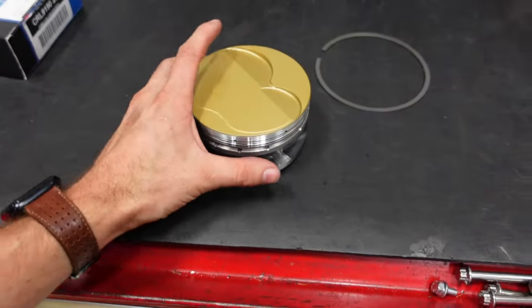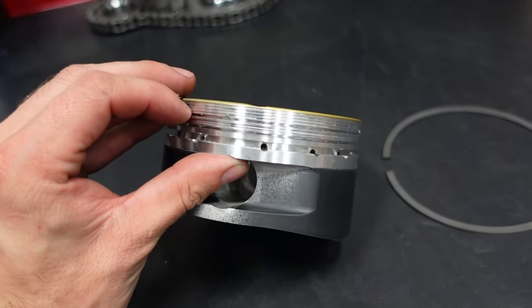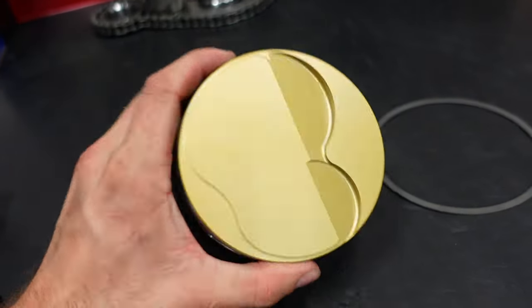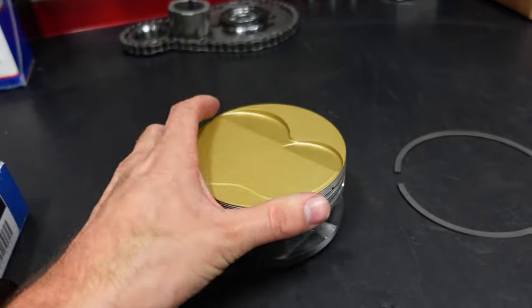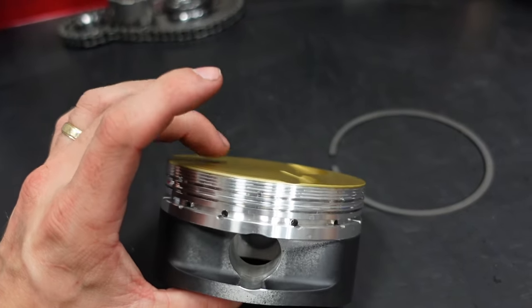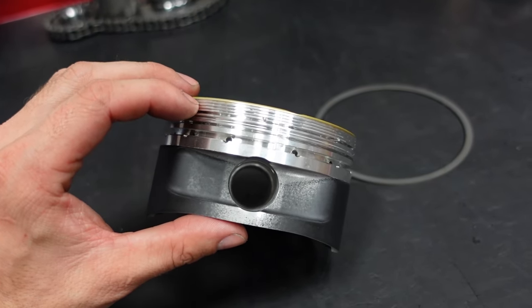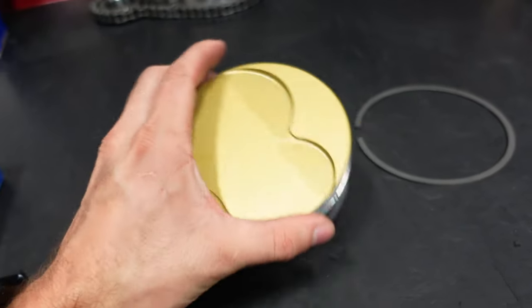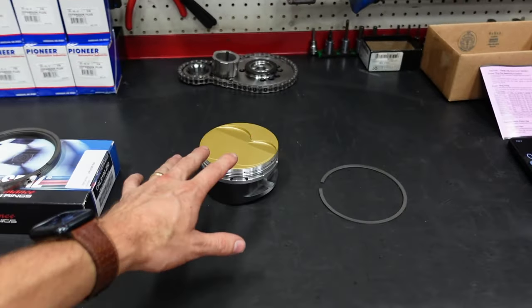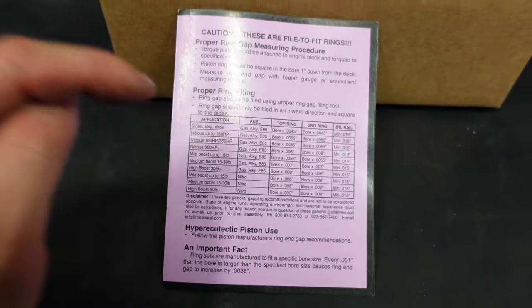There are exceptions to the rules. Sometimes, depending on where the piston ring is in relation to the piston — on a very high horsepower power adder piston, you'll see that the top ring groove is moved down more on the piston than a standard naturally aspirated piston. This is my 2,500 horsepower rated piston going into my future engine build. Its top ring has moved very far down to keep heat away from that ring to help it survive better. If your piston ring is very high, you'll need to run a looser gap; if it's very low and away from the heat, you can run a tighter gap. But that's reserved for very high-end exotic race engines. For your standard street, strip, power adder, or naturally aspirated engine, follow this chart and you'll be good every time.